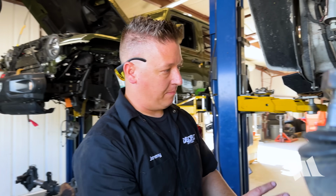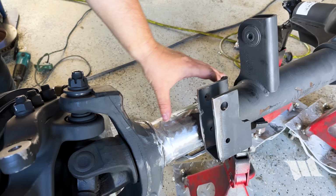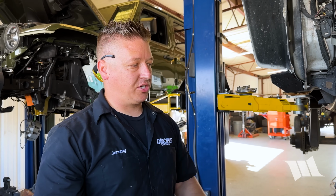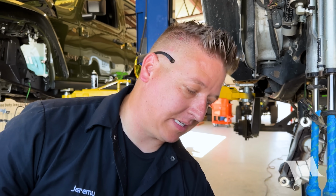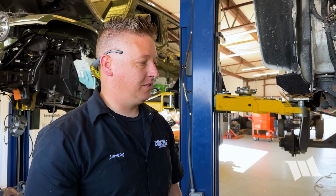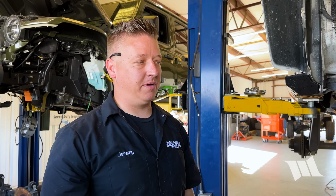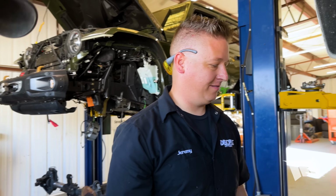And then while it's up, we're also going to orientate how much we want cut off of this bracket, the rest of it, and then we're going to set the rest of the bump stop pad. So we can make sure everything's lined up correctly and make sure we get the full stuff and travel of everything. So perfect. That way, if we do need to raise the bump stop pad a little bit to get full bump here, we can do that as well. So, awesome. Just a little fine tuning and the little details, make sure everything's working properly. Sure. Perfect, it'll be fun.